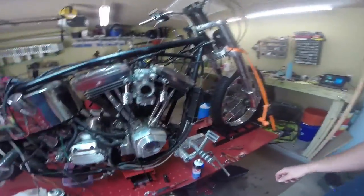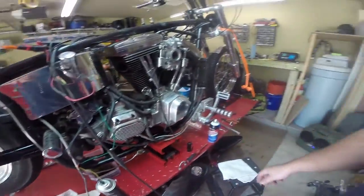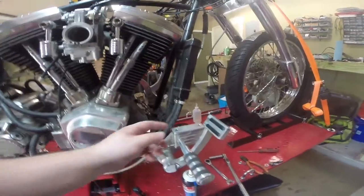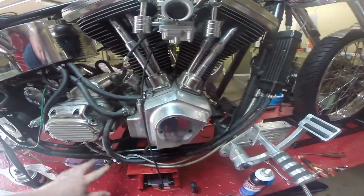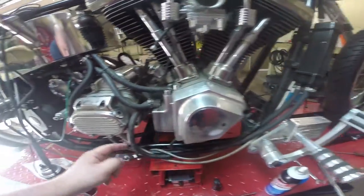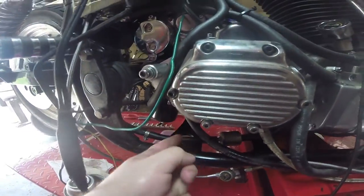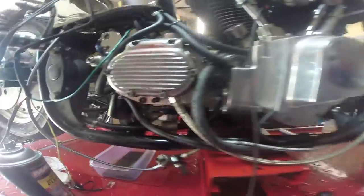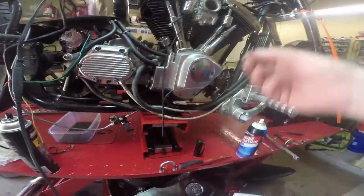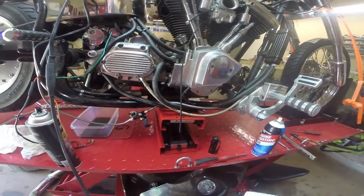Now that we got the exhaust pulled off, we can start fitting the lines. This is a bit of a mess because whoever did this half-assed it. Basically, we're going to replace these with hard lines. We'll run this down, make it jump over a little bit and run on top of the frame. From here it'll come in a little, and then there'll be a piece of rubber hose that attaches down here. The way to do this without getting confused is to remove one piece of hose, install it, then do the next one. That way you don't have to worry about forgetting which part goes where.